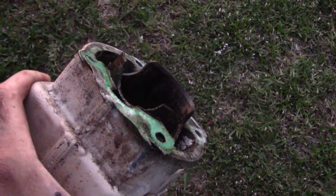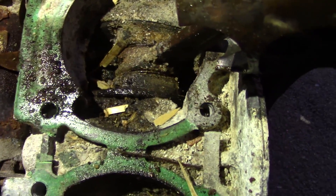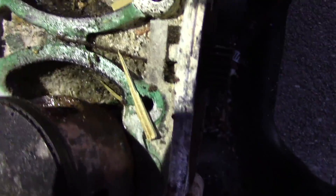Cylinder number two busted right here - there's no way to get these off. These things were heat treated with no oil and high temperatures. Looking in the crank here - look at this. Besides the shards of wood from pounding with a 2x4 piece, that is bad. You can see where I pounded the pistons here. Here's the ring on this one - it's flush, nothing left. Both wrist pin bearings are seized also.